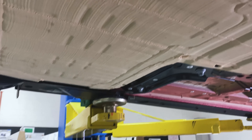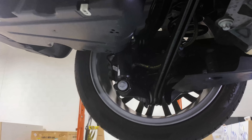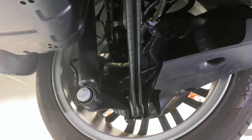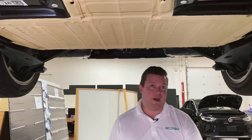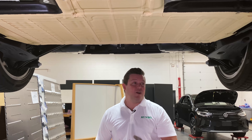The suspension front and rear is both very basic and common — nothing unique there. This is an EV, but it is not built from scratch. Some of the early EVs, like the EV1, and some hybrids like the Volt, have a T-style pack because this area is where your fuel tank is on an ICE vehicle, filling a large cross-car void. They fill that with batteries, and then the tunnel is voided by primarily the exhaust system — or in a longitudinal configuration, the transmission and drive shaft.